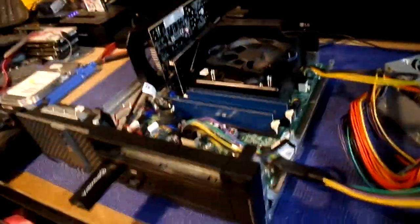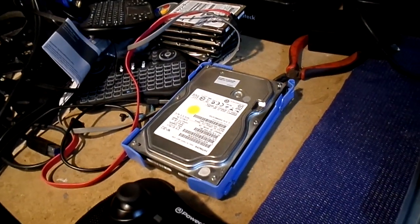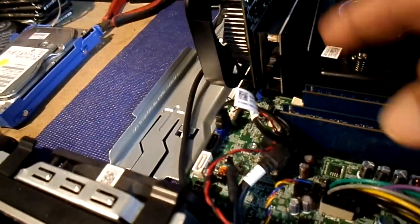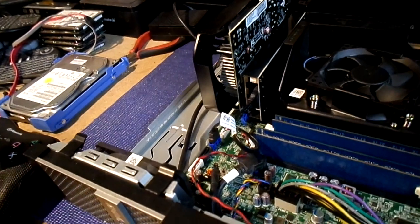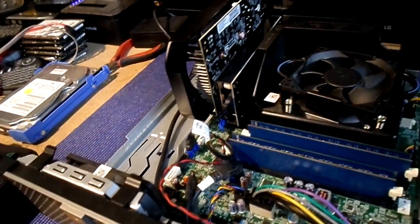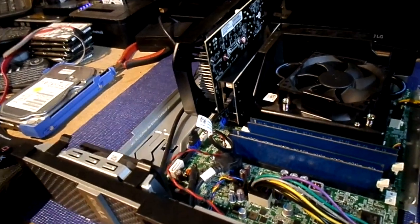I got rid of the brick hard drive from hell — if you drop it on your foot, you're gonna break a toe. So what I did was I used NVMe. I got 512 gig on that, and then an SSD, because this is a combo card and it's a PCIe riser. I want to take advantage of the bus speed on it. With NVMe it's like 2,000 megabytes per second read, and with a regular SSD it's 600 megabytes per second read speed or around there. So I want to take advantage of the speed.